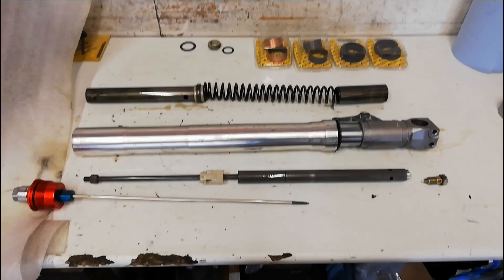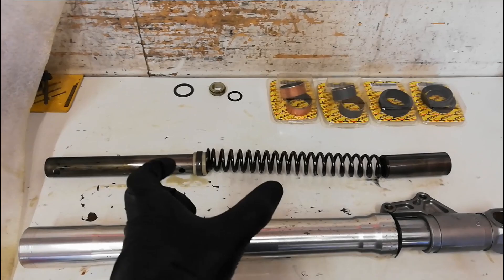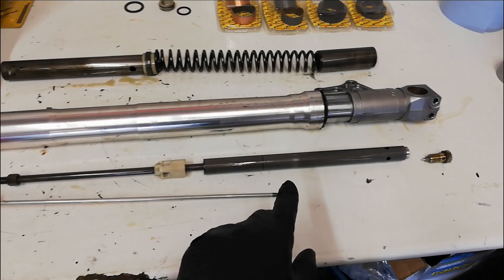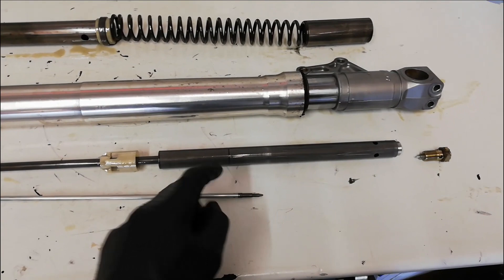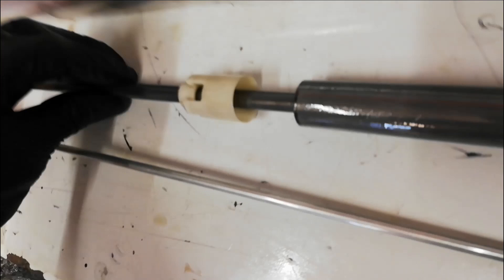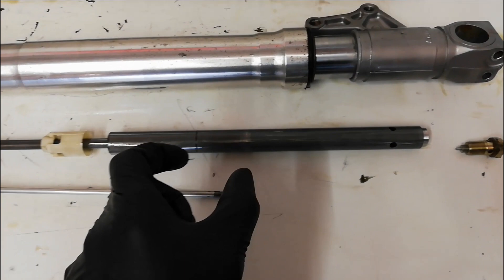The Obsession Engineering basic instruction on how forks work. The outside of the fork is relatively straightforward - you've got two bits of metal that slide in and out of each other with bushes and seals. Inside there you have springs and spacers so everything's the right length. The important bit for ride quality is the damper assembly. These are a cartridge fork - inside the cartridge, on the end of the shaft, is a piston with shims, similar to what we showed in the shock video. As you ride over bumps or brake, the piston moves up and down within the cartridge, which is sealed like a piston ring, and forces oil through a shim stack on both sides of the cartridge.